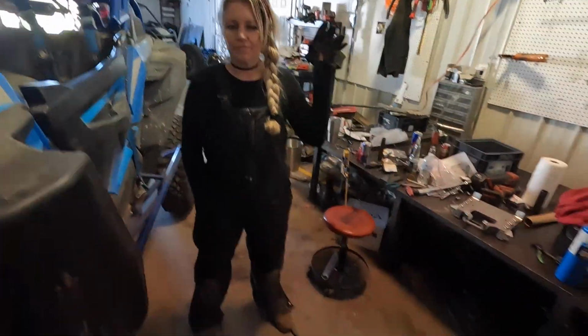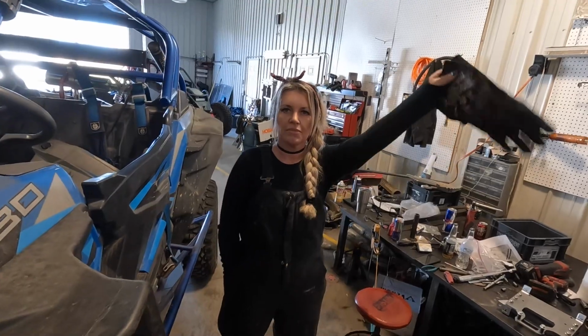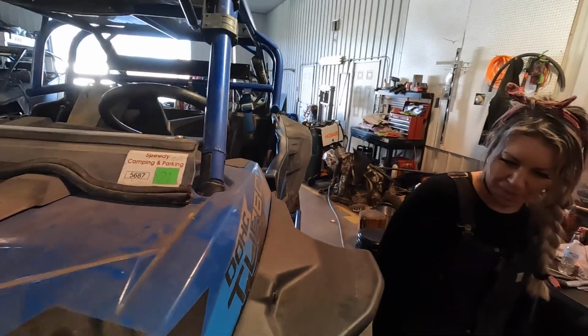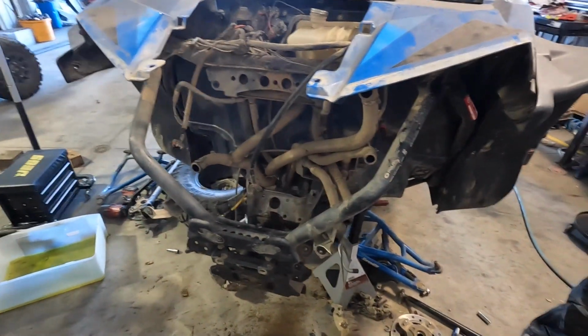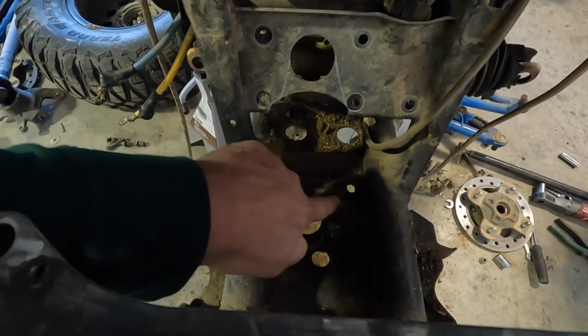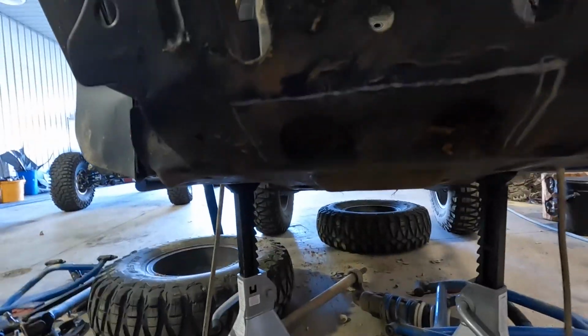But yeah, so we're swapping these units. I got my plasma cutter there. It's a 90s model. I'm just kidding, it's an 80s model. We've gone ahead and ripped everything apart there because we've got to get in there. We've got to cut that out, get a grinder in there and grind down that edge, do a little notch in there, and cut this piece out